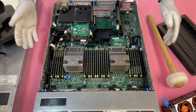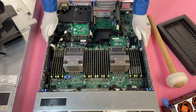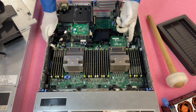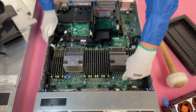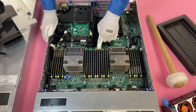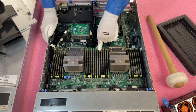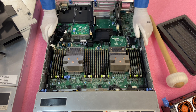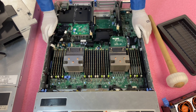We've fully loaded it up — it was a really simple upgrade overall. This is one I always tell people: if you're new to installing RAM, this is one of the easiest upgrades you'll do. One thing I also recommend at the end is to double-check that all your tabs on the memory modules are fully in. Every once in a while one will be jutting out just a little bit, and that module is actually not fully inserted — it will register as a failure. So just make sure everything is fully flush and then you are good to go.